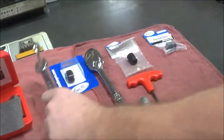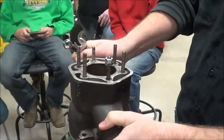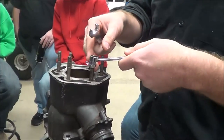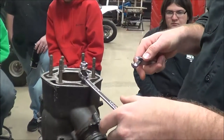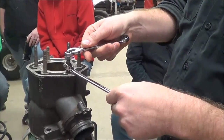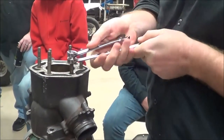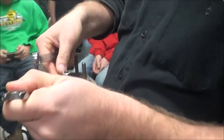I need to think about the direction I'm applying force because I don't want this cylinder to pop out of the vise. I'm going to get my bottom wrench down on here, then place the top one. I want to use the closed end of the wrench — the reason is it doesn't slip off. Now I can grab onto this bottom nut while supporting the cylinder.